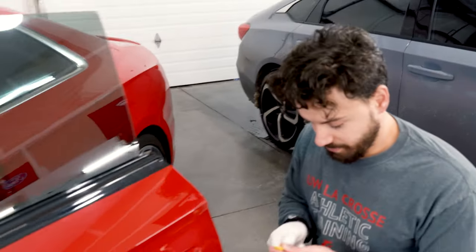The top section is done and the strip here is done. We're going to apply this last little piece. Take a towel with alcohol and clean up everything including the area surrounding the chrome — for this one we're applying a piece that covers this whole thing in one piece so it looks uniform. This piece is going to be a little short if we apply it straight, so we're going to tilt it a little bit so it covers the chrome all the way around. This is Avery Dennison gloss black vinyl — you can apply this in any direction, it is not directional.